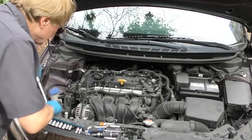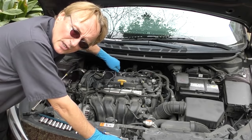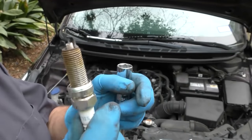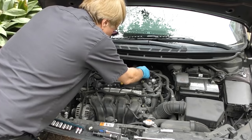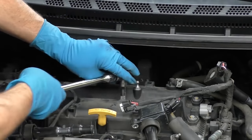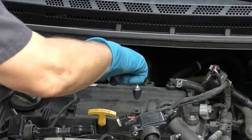So put the coils back and take the other one off — we're going to check the spark plug. And lo and behold, the spark plug is loose — it's not in tight enough. We're going to check it out anyway; it doesn't look bad, but since this one's loose we're going to check them all. I'll probably replace them anyway. Taking them all out, a couple of others are a little loose too.